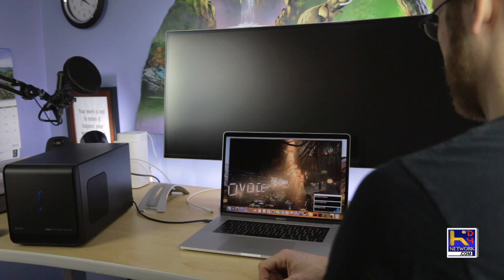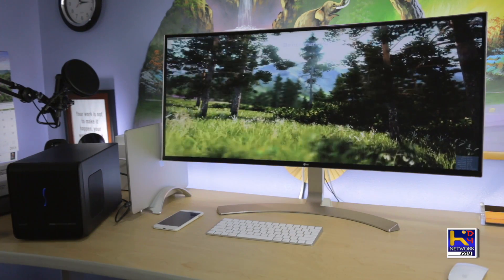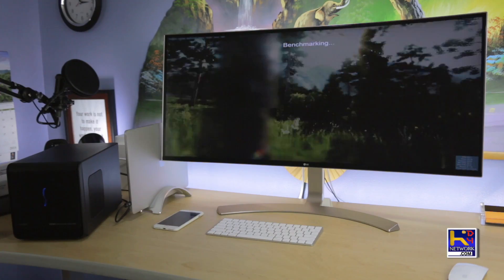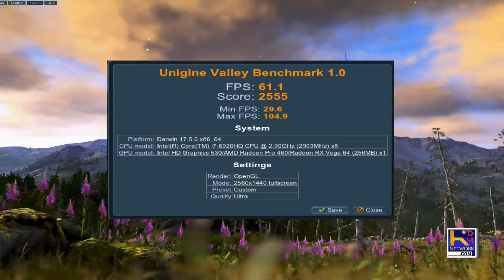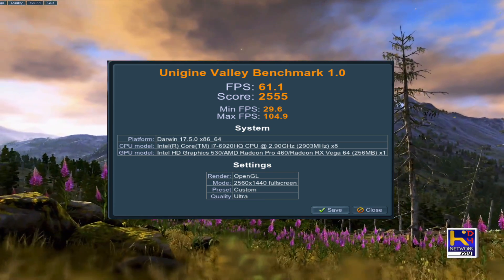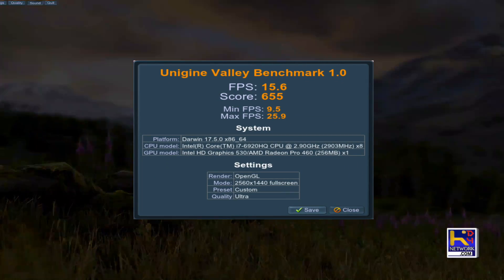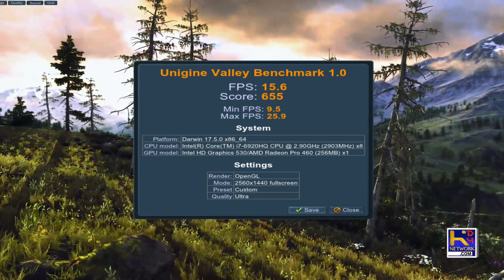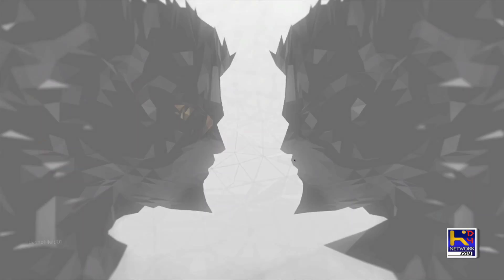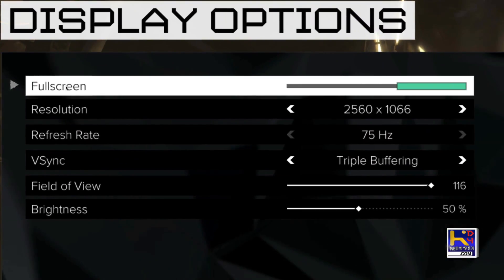This is something Apple's got to get fixed in the future because it is supported on PCs right now. Connected back through DisplayPort, running a Valley benchmark at ultra quality 2560 by 1440, we get a pretty impressive 61.1 frames per second with a score of 2,555. Comparing that to the same settings with the internal GPU, we're at 15.6 frames per second with a score of 655. Wow — and this was the top of the line maxed out 2016 MacBook Pro, ladies and gentlemen. Vega really drives some graphics.